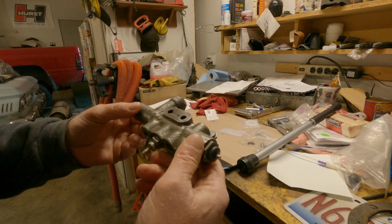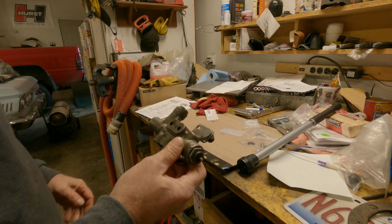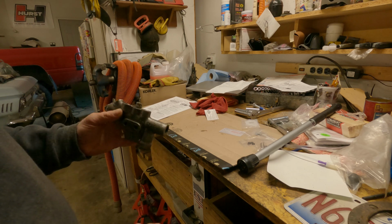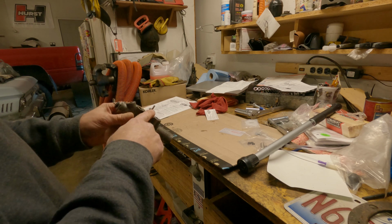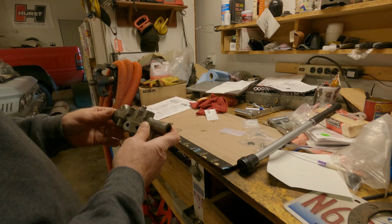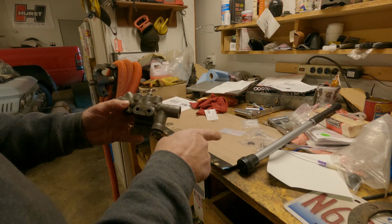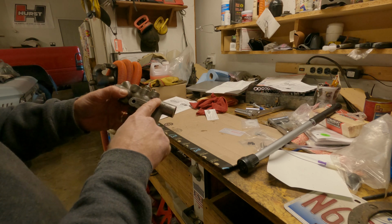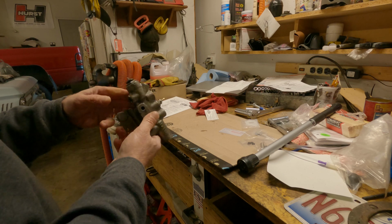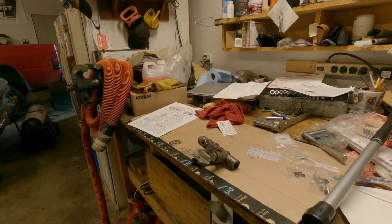Cleaned up. Just took the wire wheel to it. I think that I will just dust this with clear. Stupid, yeah, probably, because it'll go bad again. So this is for your brake light, right? So if you blast out, this is the rear port for the rear brakes. If you blow the line back there, the shuttle will go in there and set your light off. So anyhow, can you guys see okay? Let's get you a little closer.